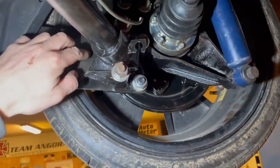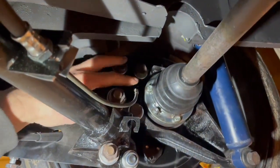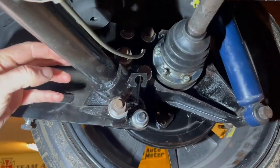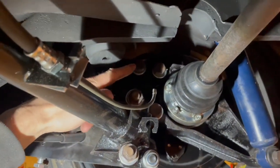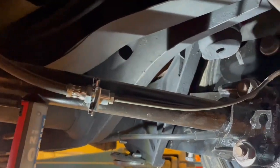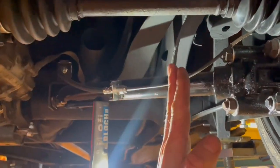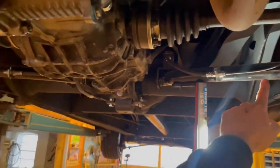You can see here — I just have to move my lamp. If I didn't have a horseshoe on this trailing arm or IRS arm, it would be way up here in these four holes. By using a horseshoe you can drop your IRS arm quite a lot lower. Two things that works for this: one, if your IRS arm was way up here it would hit the frame of the car and make noises, and it would cause a lot of camber because this piece would be way up here making the wheel tilt.